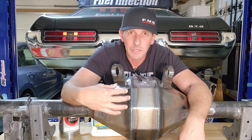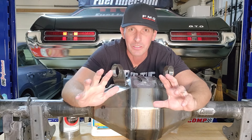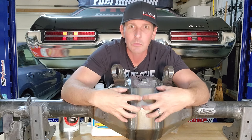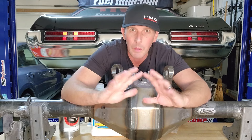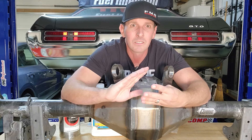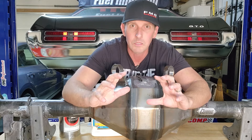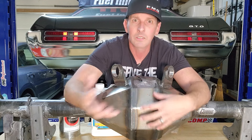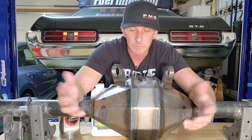We need to talk — it's not me, it's you. Some of you are going to skip this step and wonder why your Cerakote or paint doesn't work. It's because the surface needs to be oil and grease free, and it has to be etched before you apply Cerakote. When you paint anything, there has to be no oil, grease, fingerprints, or debris on that surface for paint to stick. And more importantly, it has to be etched if it's metal — that's why you've heard of self-etching primer applied directly to metal, and then paint goes on the primer as the glue. But Cerakote doesn't need primer — it just has to be etched.